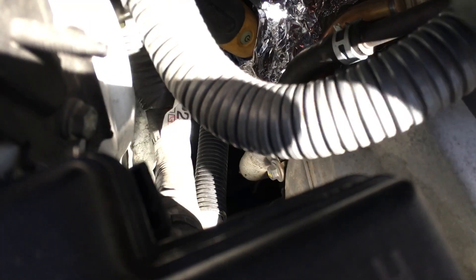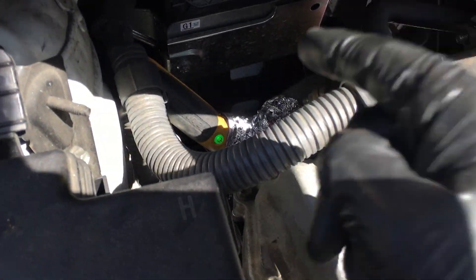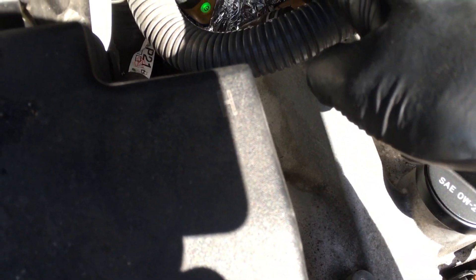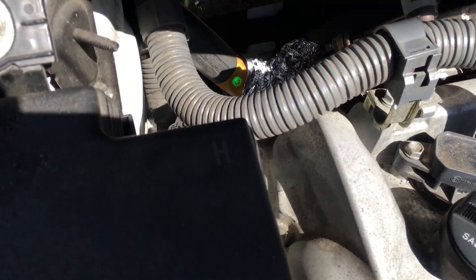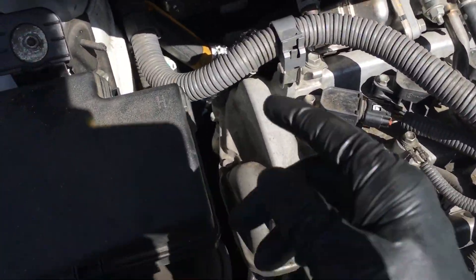There's another liquid line about one and a half to two inches away from the exhaust manifold. The clamps do not like 500 to 600 degree radiant heat cooking them while you're driving down the road with the hood closed — that's a very bad situation.